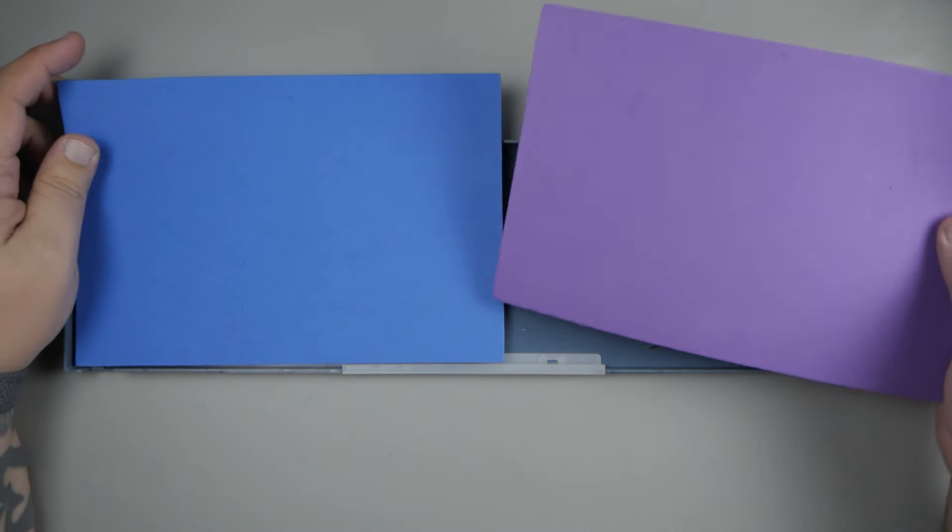After we're finished with our case, we're going to move over to our PCB. Here you can see we're applying masking tape — also known as painter's tape — to the back of our PCB. We're going to do two layers, and this will also help with the sound while typing. It's a super simple mod, really easy to do, and one of my favorites. We'll just trim the sides, then flip our PCB back over, grab a small screwdriver, and make starter holes for our posts through all the big holes. Just focus on the large holes that are through the PCB — just poking little starter holes and using the posts is pretty easy.